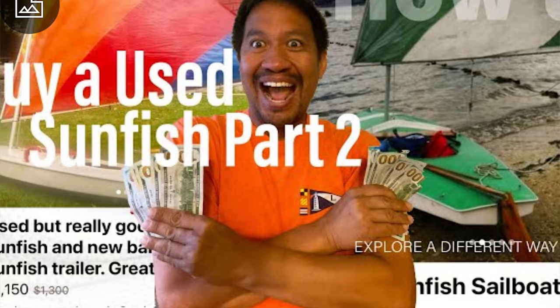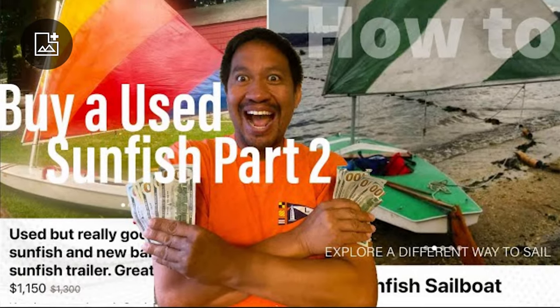In one of my old videos — 'How to Buy a Used Sunfish Part Two' — I mentioned that if a sunfish you were thinking about buying had a broken or rotted end of the spar, you could cut the end using a hacksaw and then drill new holes. Commenter alcourt teens 4707 strongly recommended, in all caps, to definitely use a tubing cutter instead. Al is totally correct — if you're going to cut tubes like a spar, get yourself a tubing cutter at Home Depot, Lowe's, or a hardware store and it'll make a nice clean cut. Thanks for the recommendation, Al!